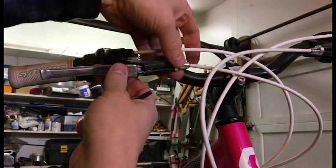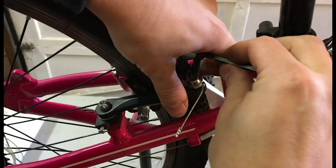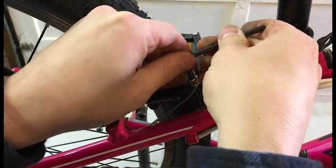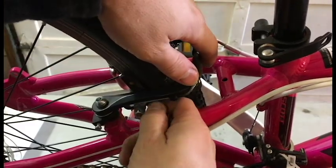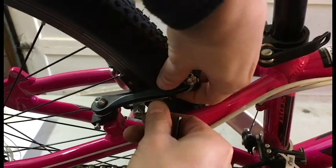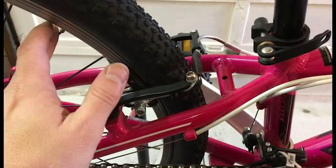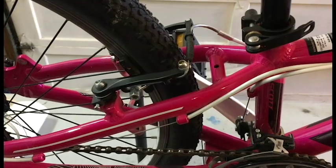Now same thing for the rear. We'll roll them out to where they're just barely sitting in there. Tighten up that Allen. Good and snug. Now when done, there's a little lip here - you can just tuck your brake cable behind it. Give it a little curve so it curves back out so it doesn't rub on your tire. Stick this back there and it's out of the way with a nice bit of cable. Wind back the barrel adjuster - right now the brake is snug. Brakes are good.